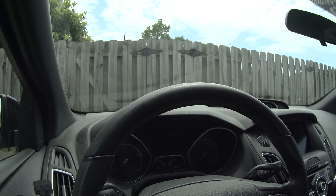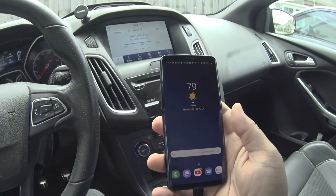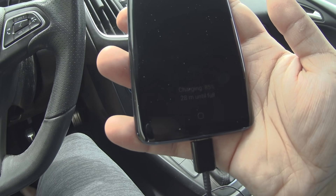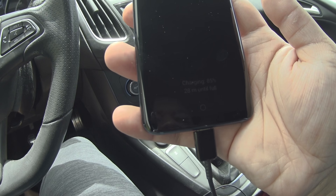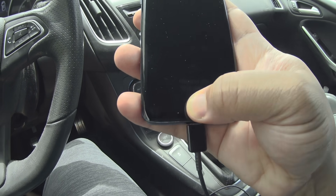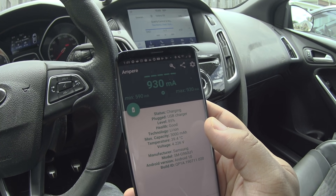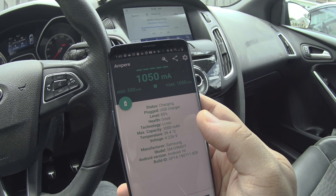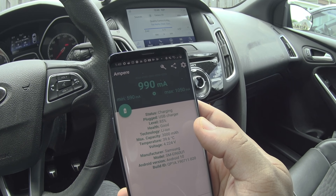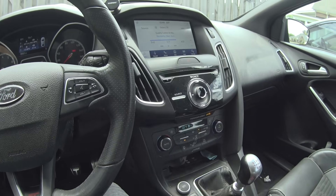The first phone we're gonna use is the Galaxy S9. We're plugged in — with the screen off at the bottom you do see it says charging. It doesn't say charging slowly or fast charging. Right now we're getting a charge speed max at 820 milliamps. We got 930 milliamps — now we have over an amp. Max was 1050, so that's what we're getting max right now with this USB hub. It's kind of going up and down, but max was 1050 — that's what the Galaxy S9 is pulling.